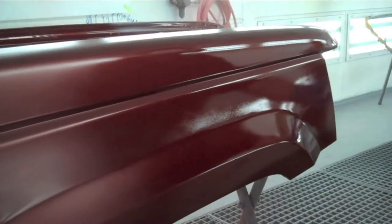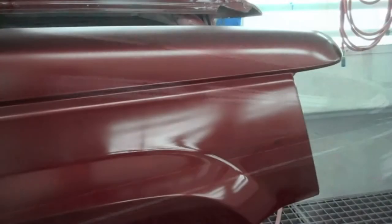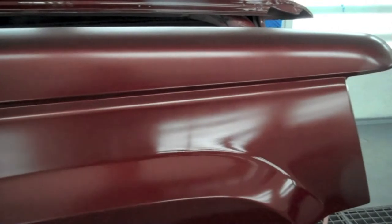to come up and sit on top of the metal flakes. That way we can make a silver — like most of the metallics are — into a blue metallic or a green or a red, etc. So if it is not oriented properly within the film itself, we're going to get all kinds of freaky things with the metallic and the pearl. We'll get colors that are gray and blotchy and streaky. So we want that flash time to take place.